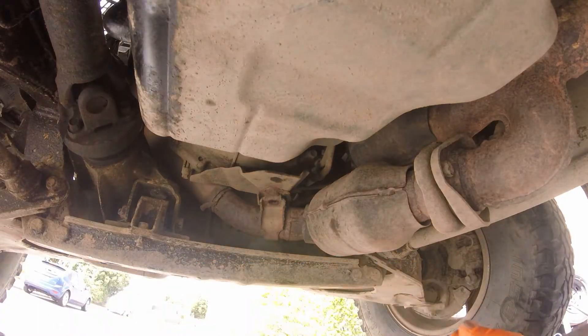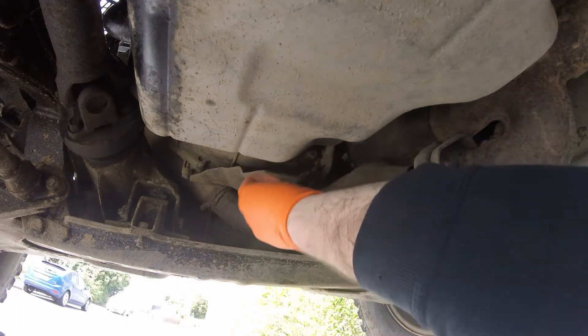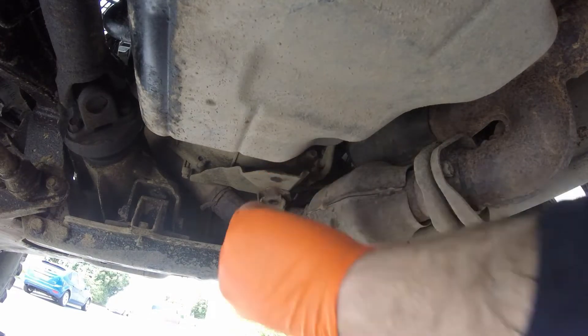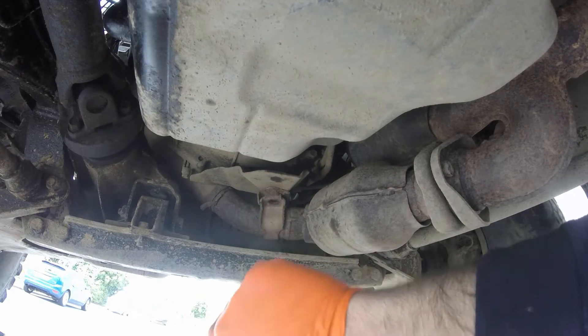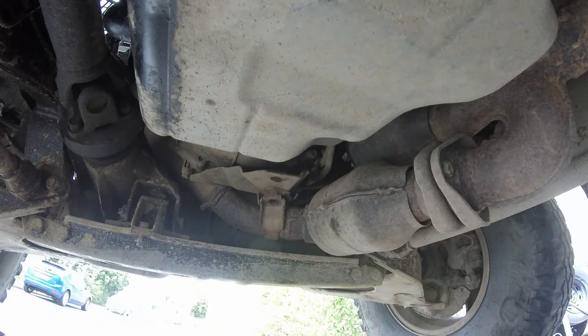Right, so welcome to the underside of the truck. As you can see, this is what's rattling. I'm going to clean this off and then buzz a bit more weld around there, because it's supposed to have a bolt through there but that's been snapped off. Somebody else has welded that part on and that weld is actually cracked.